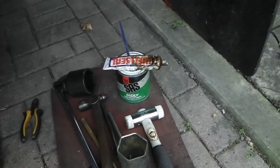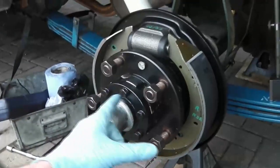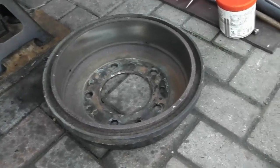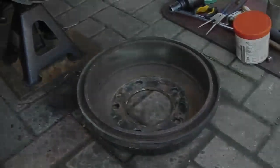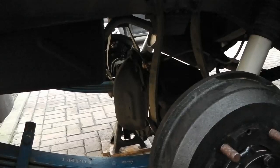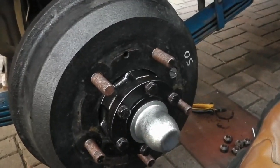Just to help them last a little bit longer. We're pretty much done this side, so I'm going to put the brake drum on now after I've given that a little clean, then get the wheel on and we're done this side. I'll then torque everything up once it's on the ground, then onto the other side. The brake drums are still very serviceable - they've been on a few years now but there's very little wear on them, so I've just given them a clean with brake cleaner. Both hubs and brake assemblies refitted, so we can get onto the front axle now. I'm going to refit the wheels - I lock the drums up on the adjusters and then torque these up, and I'll torque the road wheels once it's on the ground.